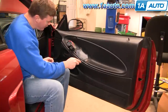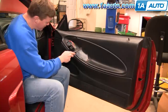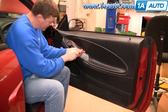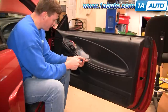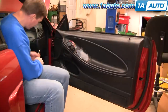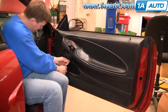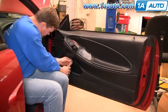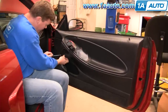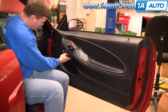On this vehicle there are two Phillips screws right here. From past experience, there's either a pin like there was down here, or a bolt. I'm going to remove these two Phillips screws, and keep in mind there may be another fastener here as well. Around your door handle, just insert a screwdriver. You want to pry the bottom first, not the top, and pull the bottom out and off.